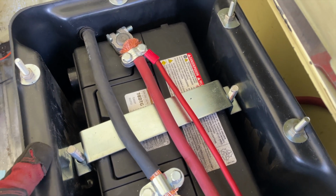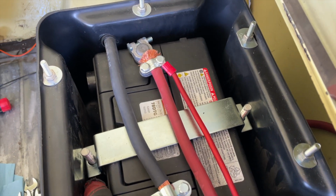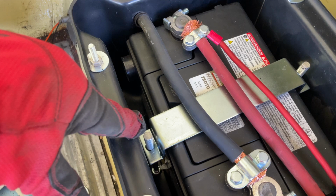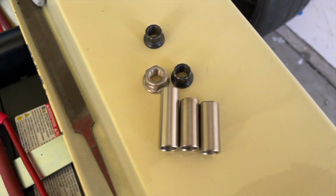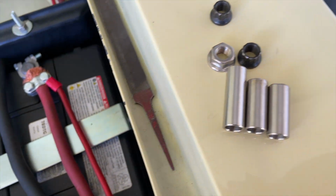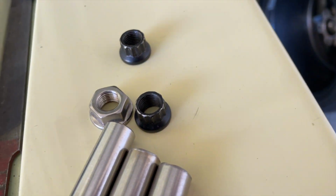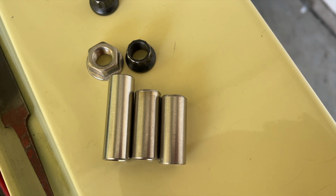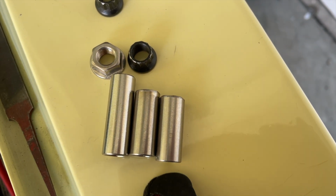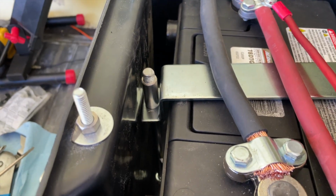They could have just made this box just a little bit larger, so you could actually get a socket down in there, move the hole out on the plate so you can get a socket down in between, because it binds up there. So what I did is I got some bushings, similar to what I did for the lid, and it also originally came with these 12-point nuts. Hate those, so I'm replacing those as well. The bushings were a little long, so I cut those down and made them the right size, and this is what they do. Boom, just like that.